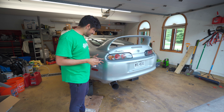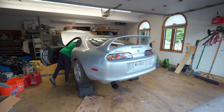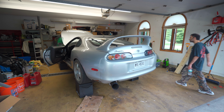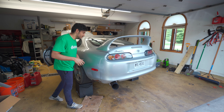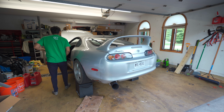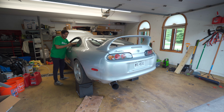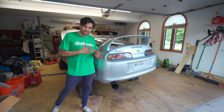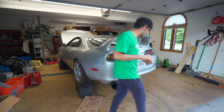Okay, moment of truth to see if I should quit my welding career now or there's hope for me yet. I don't have great expectations. I forgot the intake recirc pipe for the idle air control. It was a vacuum leak. Okay, so it's leaking from the turbo side, so not the bent V-band. So maybe if I just tighten that one up, I think we should be good.